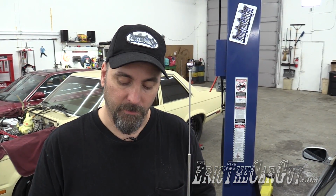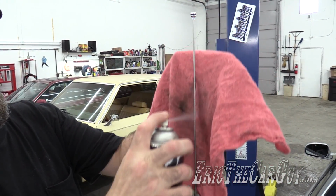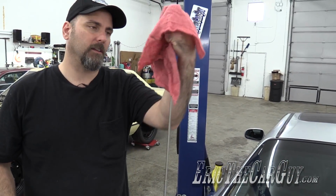Periodically, they require cleaning and maintenance. Do not use penetrating oil. The preferred thing is silicone spray. I used to do it during the services, which were about 15,000 mile intervals on these vehicles, and that seemed to work okay. But silicone and a rag, and I just take it and spray. And then this will clean and lubricate it, and it won't harbor the dust.